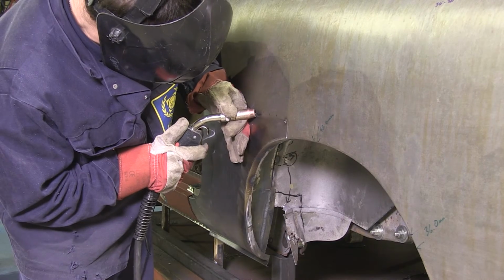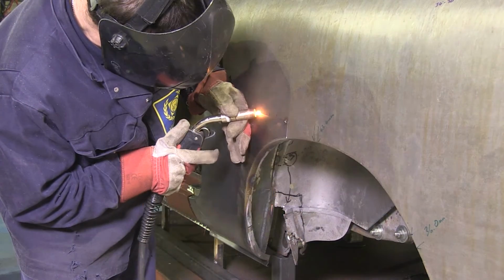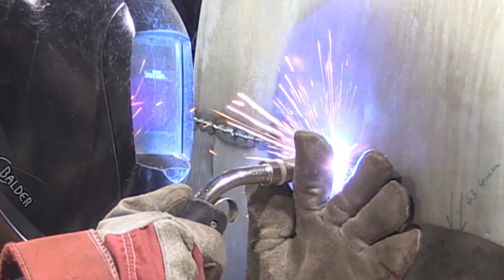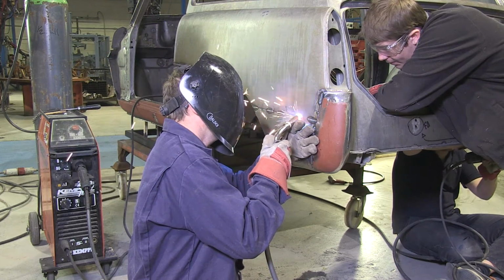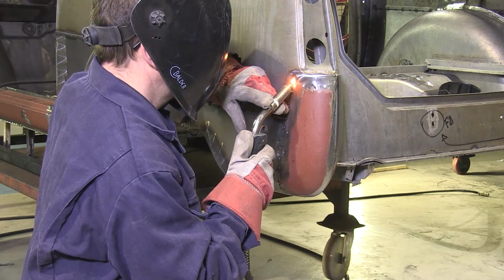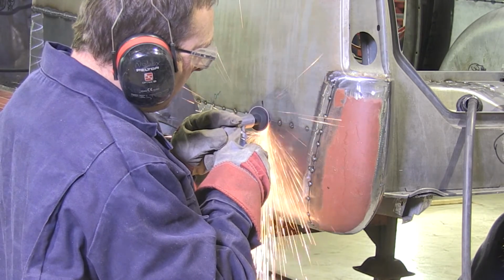Rear wheel arches and wings proved to be a greater challenge than we'd expected. For the outer wings, we kept the best of the original and replaced the rotten parts with sections cut out of the new Radford panels. A tricky bit was under the rear lights, and again, this was replaced using sections of the new panels combined with pieces fashioned from flat sheet.